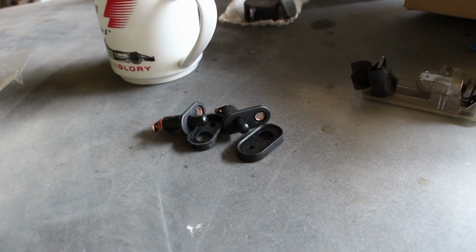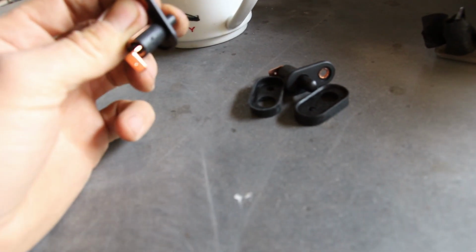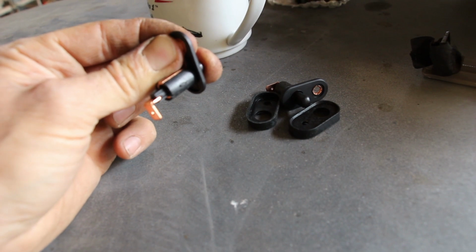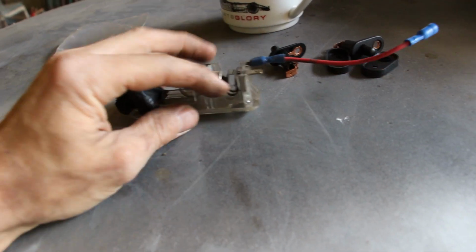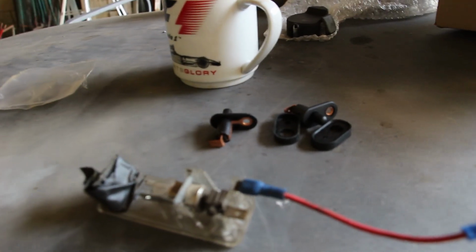Important things. So all the complexities of the Mini, the interior light. You have one of these in either door, which makes contact with earth when the door is open, and then breaks the contact when you shut the door. And the interior light gets a permanent live there, and then these two here, one is a switched earth by the doors, and the other one you flick across and you hit the earth and you get an interior light. So we have three wires just behind here. We have the wires to the doors. Let's fit these babies and see if we can make it all work.